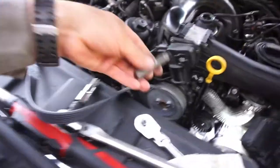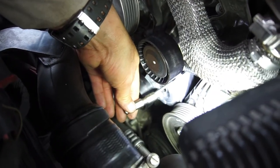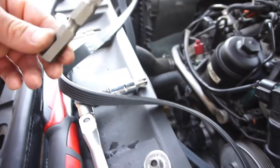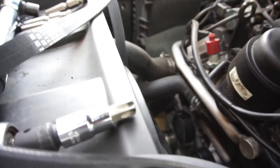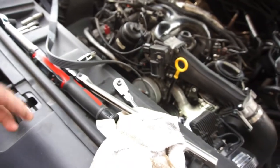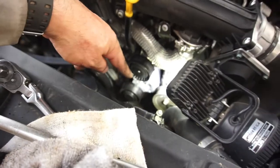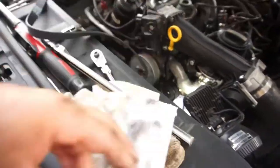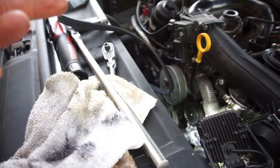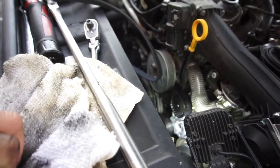That's an M12 — the M12 is 50 Newton meters plus a half turn. I went 50 Newton meters and probably about an eighth of a turn. The other three I did 20 Newton meters — they call for 20 Newton meters and a quarter turn. The tensioner is 50 Newton meters with a half turn, but I'm not doing the full half turn because they're aluminum bolts and they'll break. I'm gonna route the belt, release the tensioner pin, and fire it up.